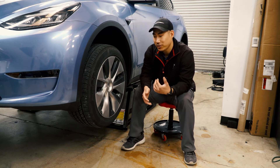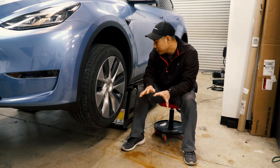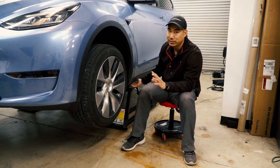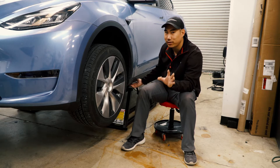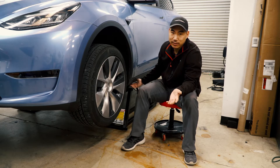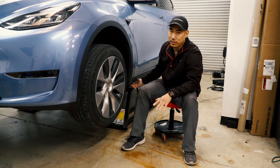When lifting up your Tesla, if you don't lift it up correctly, you can really jack things up. Part of the reason why is the jack points are really, really close to the battery pack. So if you do it wrong, it's going to be a big expensive mistake — it's kind of like lifting up your ICE vehicle by its gas tank. Another thing to keep in mind is if you do it the wrong way, it is not covered by warranty.